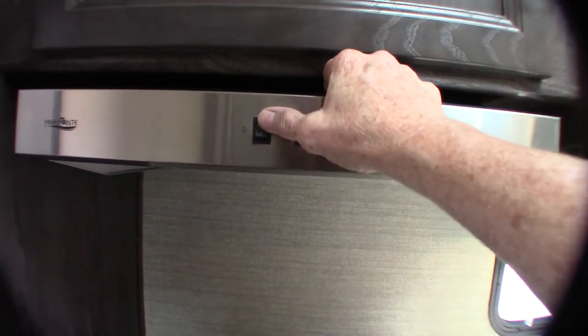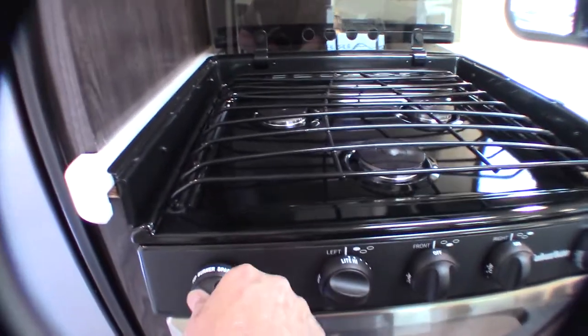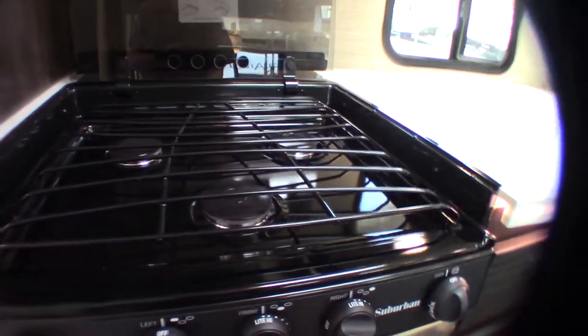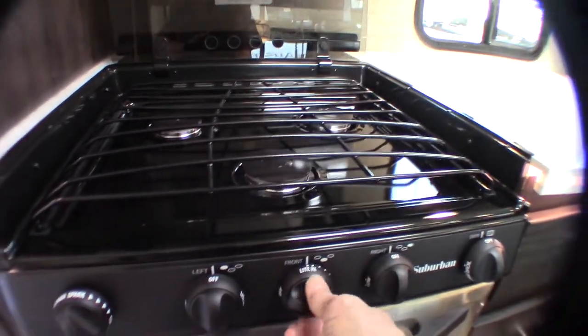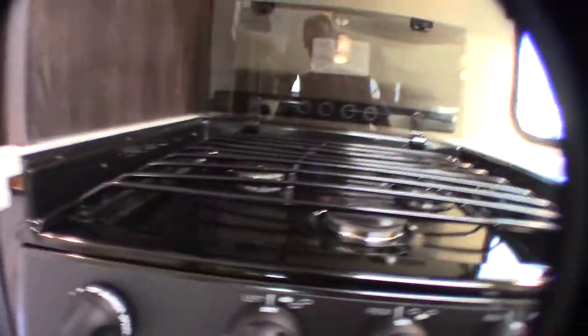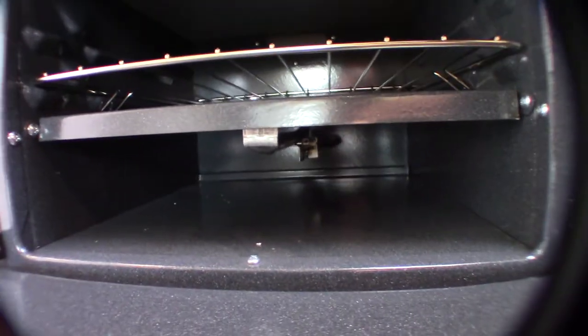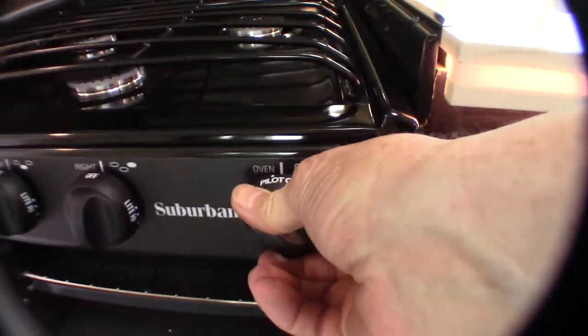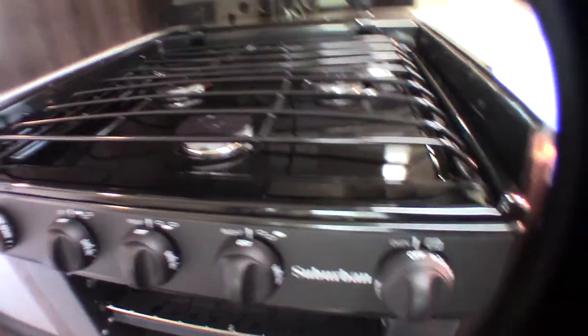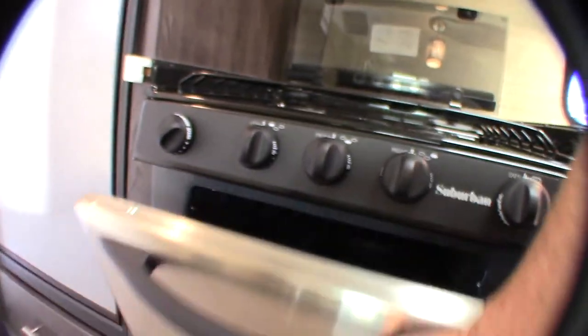I told you about the baffle on the vent outside — here's your fan, so you can vent to the outside. It has a light. Turn this clockwise to spark the burner. For the oven, you have to light it with a grill lighter with a long neck — there's a pilot light all the way back there. You're going to put the oven on pilot and depress it, light the pilot light back there, and continue to hold it in for another 10 to 15 seconds, then go to operating temperature. When you shut it off, the pilot light goes out too — you've got to re-light the pilot light each time you use the oven.